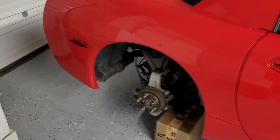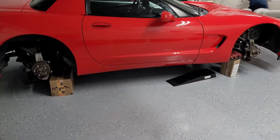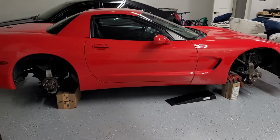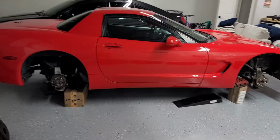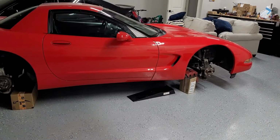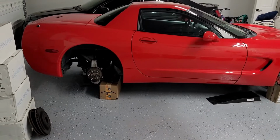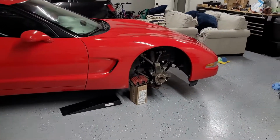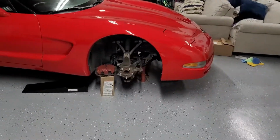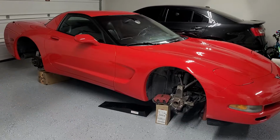So this is the car with 2 coats. I kind of screwed up. I was kind of overzealous the other night, and I went ahead and did a second coat right after the first. I probably shouldn't have, because all that did is basically thicken up the first coat. So when you do that, it doesn't harden for 24 hours. So basically I just kind of globbed up a coat, which looked fine. It looked nice and had a deep, glossy shine when I was done the first time. And this is actually a couple days later, and there's a second coat on it now.